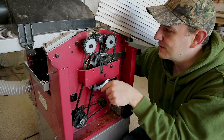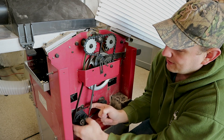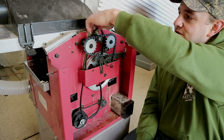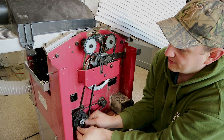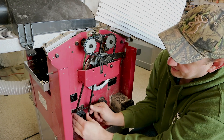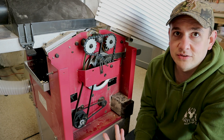Once you get it over the top of this pulley, this belt's in the way. So you just rotate this round, slightly pull the belt out, and once it pulls the belt out it comes off nice and easy — just lifts off. You can loop it round and through, thread it back onto that pulley, put it onto here, just rotate it round gently and it will seat itself in those grooves. Job done, nice and simple.